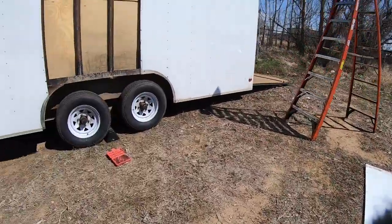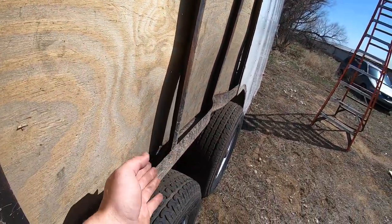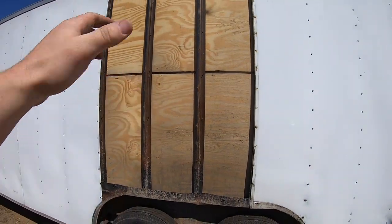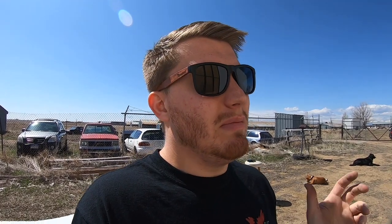As you can see I got the one panel off. I was kind of inspecting this and checking it out - really the only one that is bent is this one right here. This one's pretty good. The wood is detached from it, so I think what happened was when this one popped this way, it broke it off of this piece down here. So I'm going to go into the inside of the trailer, take off the wood that covers this up. Because this stuff is kind of messed up but not broken, not bent too bad, I think what we can do is just go from the inside, get a big hammer and smack it back, get it as good as we can. I want to put some more screws in the wood anyway so it doesn't pop off, and I want to paint the floor and do the sides to help save the wood.